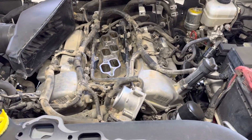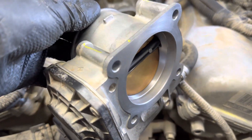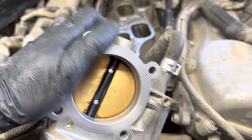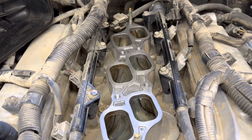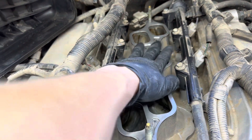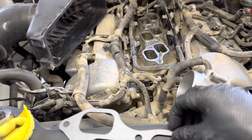The tune helped a lot as well. Before going any further, I cleaned the throttle body — Scotch-Brite the mating surface right here, make sure it's super clean so it gets a good seal. Same goes for the intake manifold plenum — Scotch-Brite everything, make sure there's no oil, clean it all up. Now you're ready for the next step.